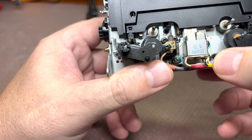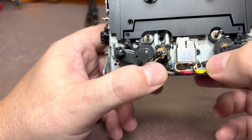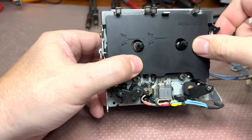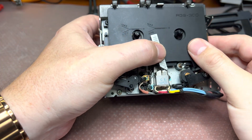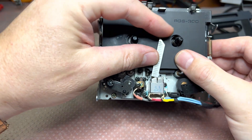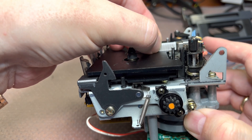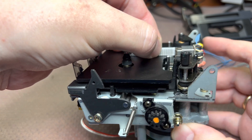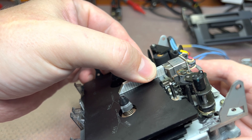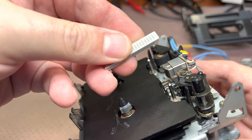You can see it still sits on the factory settings. Only the azimuth adjustment has been done, but on the right side, height and tilt are on the factory settings. We might check just to see how it aligns with what I'm doing. Height should go easily here, and tilt should be good as well. You can check tilt by seeing the light through and making sure it goes symmetrically between your tool and the head.